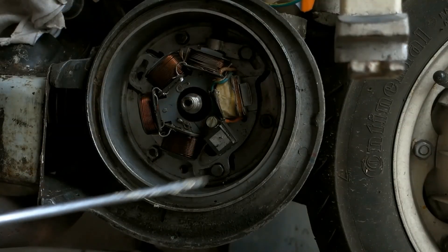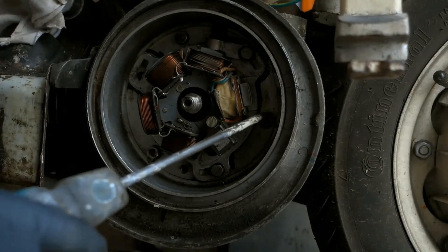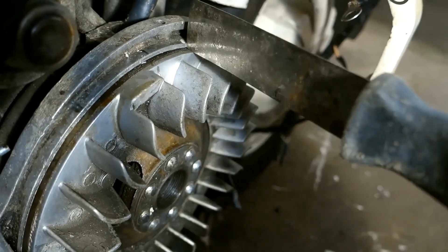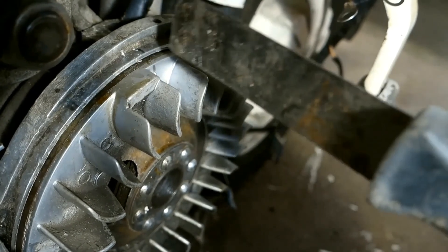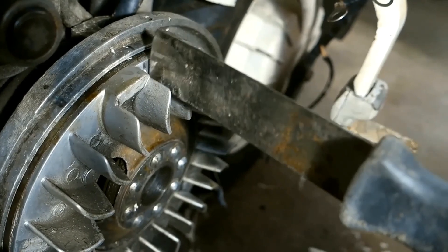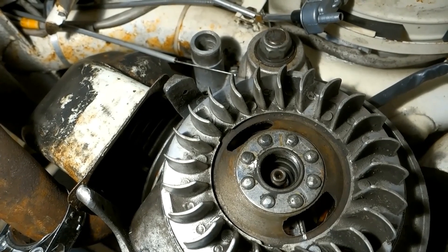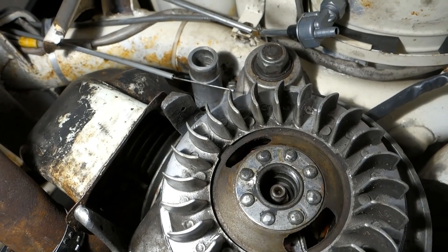The white line crossing the black pick-up coil is the timing line. I loosened the three bolts and twisted the stator plate that little bit, ink-marking the housing so I'm aware of how much it moves. Re-fitted the stator plate — turns out I could get two millimetres of movement and it's now tight against the bolts. Top dead centre. The original firing point — the black mark is 19 degrees before top dead centre. The marks on the flywheel and the ignition coil are bang on. Hard to get it to show up on camera, but it's pretty good.